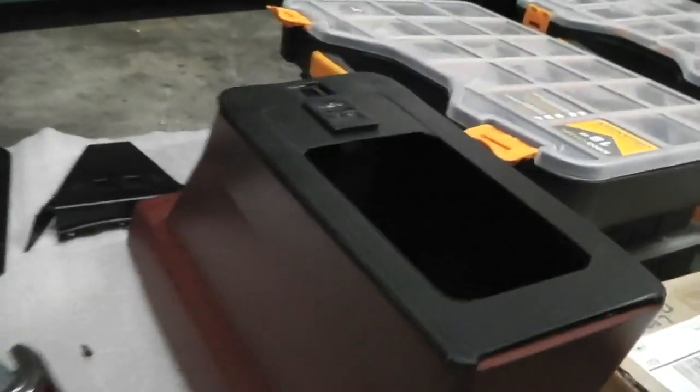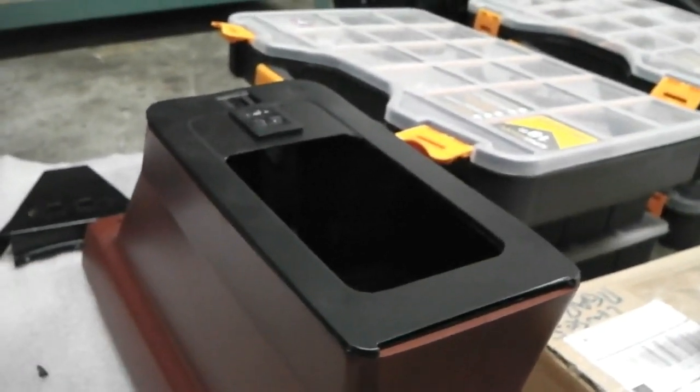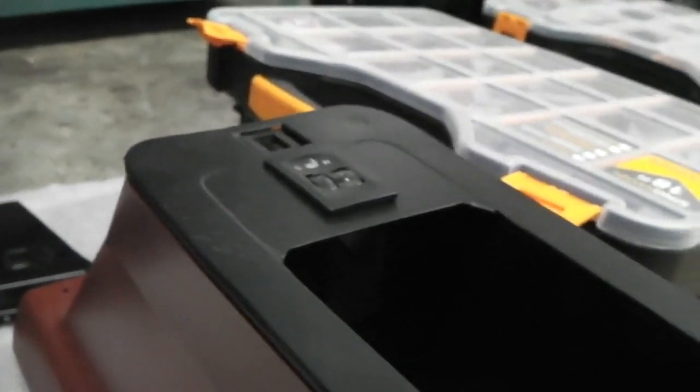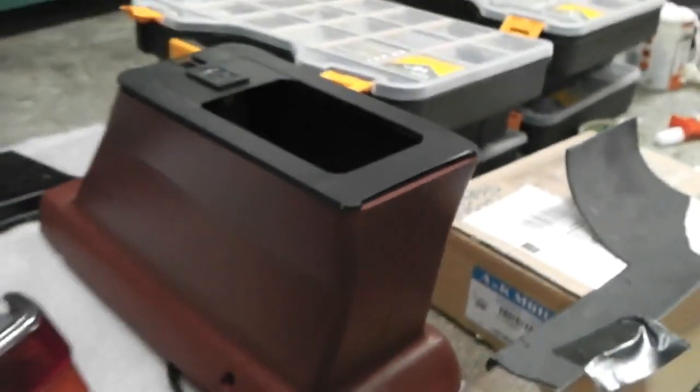So that's that. The armrest centre console bit, we were looking for places to fit the heated seat controls. We've made an inlay panel there. That's spot welded in. Simply a piece of metal, and then it's cut out to take the switch, so the lid will fold down, and it'll hide the controls for the heated seats. The profile of the switch is okay because the lid has some rubber feet on it to stand it off, so that actually fits. I've tried it, so it doesn't hit the switch when you close the lid. Okay, so that's that.